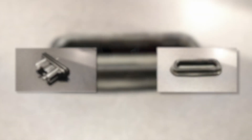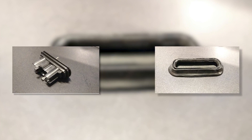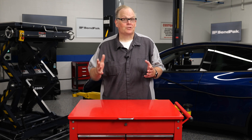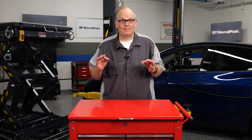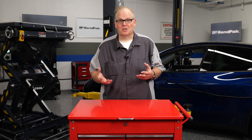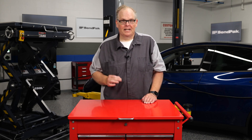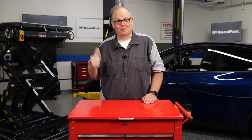To reinstall the battery pack, replace the seal and retainer clip. When installing, positioning the connector and battery pack is critical. Trying to make millimeter adjustments while the battery is on a pallet, cart, or other repurposed furniture is impossible and can lead to damage to the battery pack and RapidMate connector. This is why you need a specially designed EV lifting table like this one.